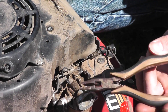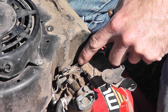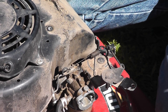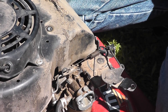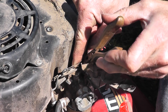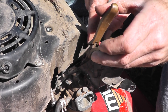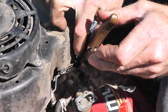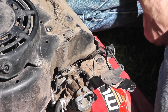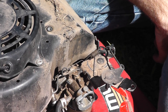What I'll do is take my handy needle nose pliers and put just a little bit of a crimp in this spring right here to make it a little bit shorter. Depending on your mower you might have to improvise on the way that you tighten up the spring, but this is the best way I can figure out on my mower. Now that spring has a nice little dog leg in it — I'll start up the mower and see how she sounds.